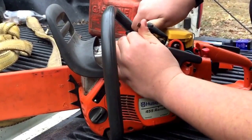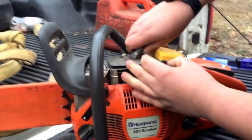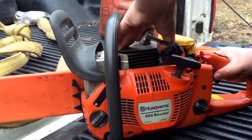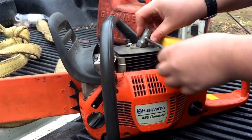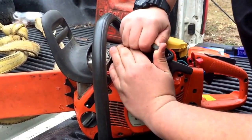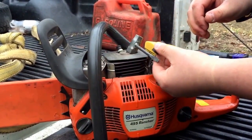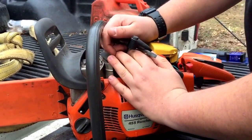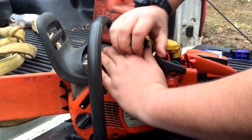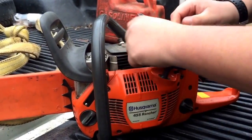So be careful not to strip out a spark plug. I've never done it, but I know it can be done. I've had one come out on me before, though it wasn't my fault. A shop put spark plugs in a truck, and one flew up and put a dent in the hood. They had to put in a helicoil, I think it's a helicoil, but they had to replace it. So I get it tight and then give it a little more, and we're good to go. As long as it ain't coming out, good to go.